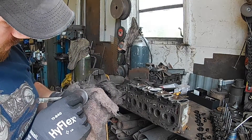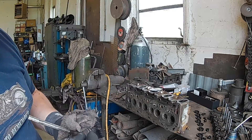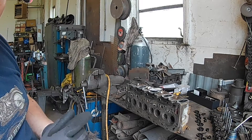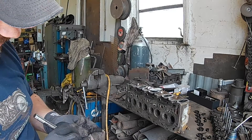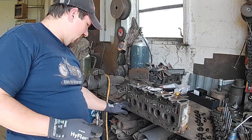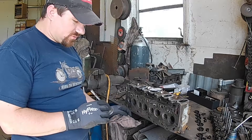That's a pretty good mating surface. I don't want to grind it too much because the thinner the line, the more pressure the spring can put on a smaller area. If I keep going, I'll widen it out and then I won't have as good a seal — it'll have a wider seating area but the pressure will be evenly distributed on a wider area, so it won't seal as good. That right there I'm going to leave alone and go ahead and clean up some of the other ones that are in a little worse shape. Some of these others have carbon and stuff around them. But that's how you lap valves in a head to get a better seat for when they're closed.